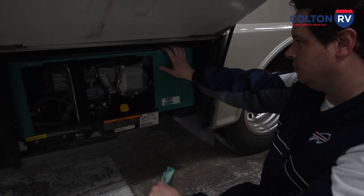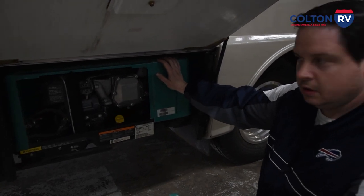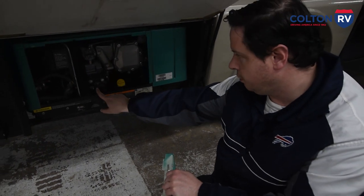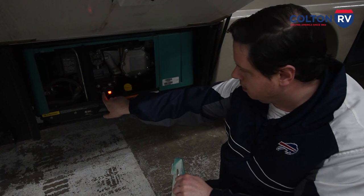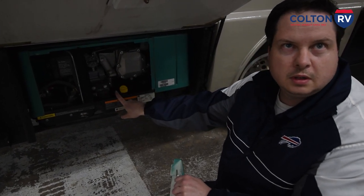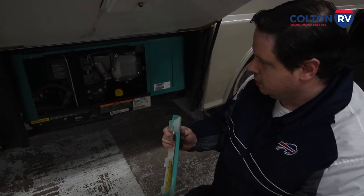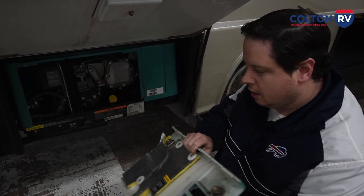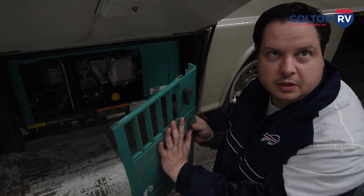You won't be stranded because it's not using your driving fuel. If you do want to start the generator from out here, this button right here is the switch that starts it. You hold this in until it glows red, and then after it glows red you hold down the start button and it will start up the generator. Important point — if you start it out here and not on the switch inside, you want to put the cover back on. It keeps it cool. Your generator can overheat without this cover in place.